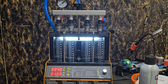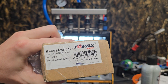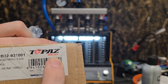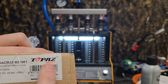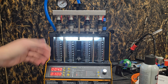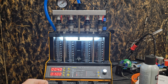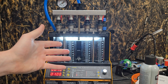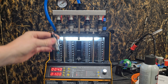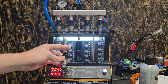Do they have any paperwork with them? No. They have a barcode on the side — Topaz. It says Germany, but then it says made in China. Maybe they do quality control in Germany — it's possible, and if that's the case, it shows. The quality and balance on these things is fantastic compared to the eBay ones. I'm pretty sure the eBay ones are just cranked out in a factory, four in a box, claiming they're flow matched and hoping you don't have a test stand to check. What ends up happening is if you have one injector putting out 100, 100, 100 but this one's only putting out 80, now you've got a cylinder running completely lean all the time — you're going to blow that cylinder out.